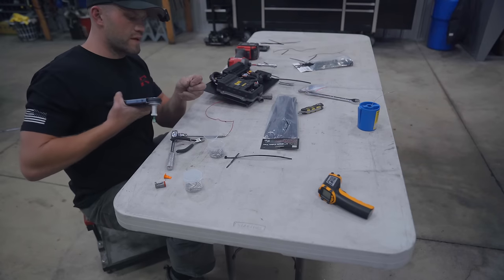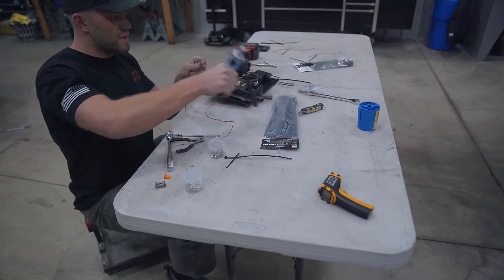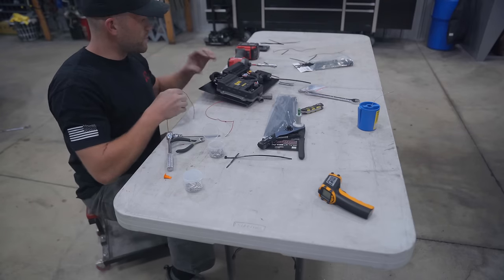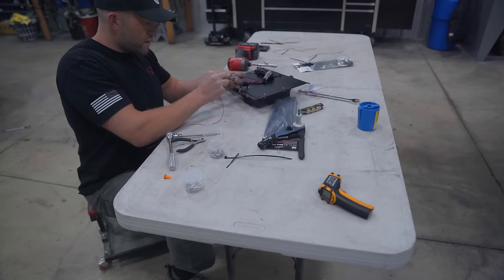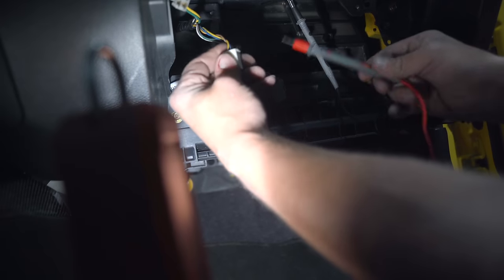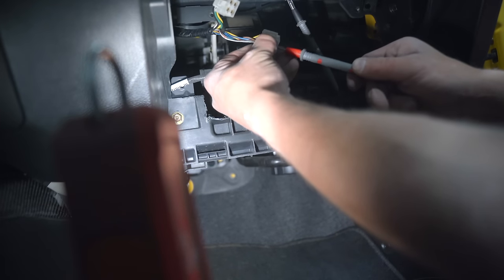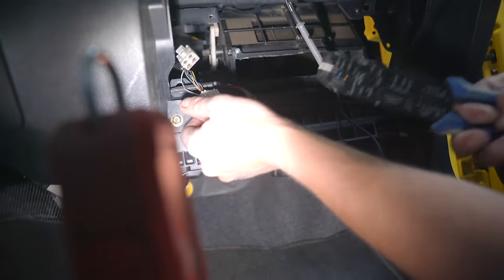Right behind where the Haltech is going to sit is the factory blower motor and a bunch of other plugins that take a significant amount of voltage. So if I'm not mistaken, I should be able to just pop in there, snag a power and ground from, let's say, the blower motor, tap into that, we'll be good to go. So here is a plug-in for something on the blower motor, and bottom left, the blue pin, that's going to be a ground, and then we're going to need a 12 volt, and it looks like we do have a 12 volt here as well, which is the white wire, and they are ignition.